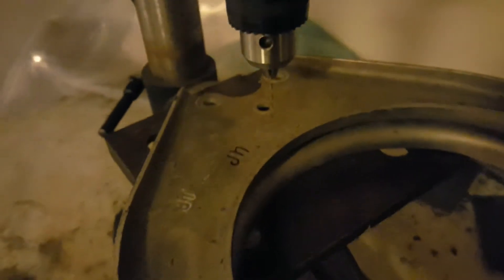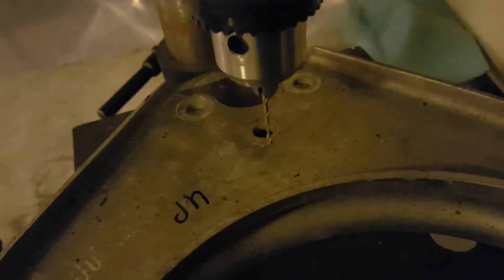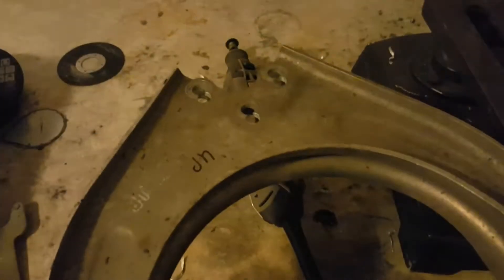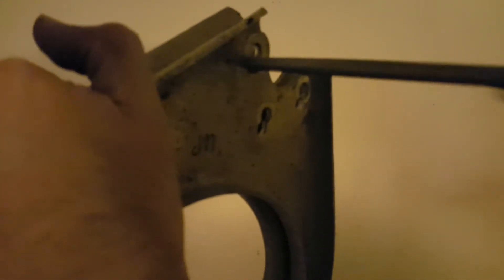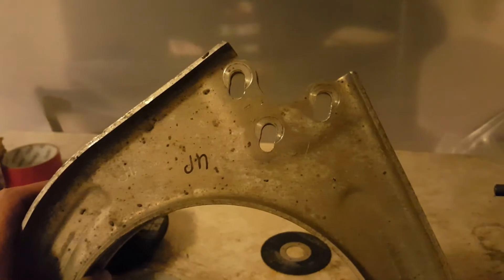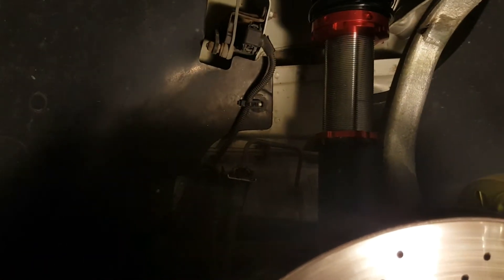I've got the upper control arm in my basement and I'm drilling holes — starting with smaller holes first since a smaller drill is more accurate than a larger one. Once the smaller holes are drilled, I move to the bigger holes with the proper size drill bit. Here's what the control arm looks like after the bigger holes are drilled. I just need to file out the middle section between the two holes, and after a fair bit of filing, there's now a fair amount of adjustability.